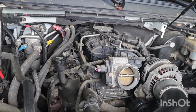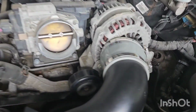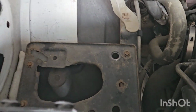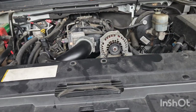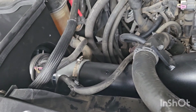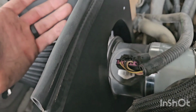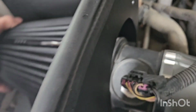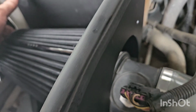Two quick notes. Throttle bodies are very sharp, so be cautious when you're trying to get that on it. It will slice you very, very deep. Second note, we have to remove those two bolts there, because that is actually what holds on the filter box. All right. Trials and tribulations later, you'll have a system that looks like this. There was nothing for me to mount this to. There was no extra parts, but it's not touching at all, and it feels pretty solid, so I'm not terribly worried about it. I'm not taking this thing dune jumping or anything.